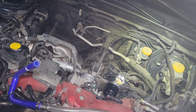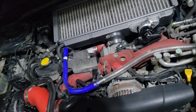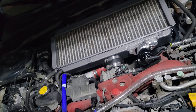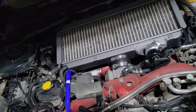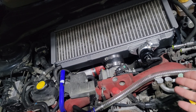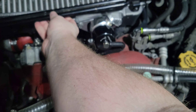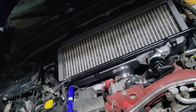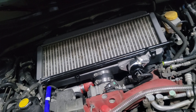The intake is way cleaner, everything's way cleaner, and the blow-off valve is installed properly - but it's still hitting the PCV pipe. I don't think it would make a difference with the Turbosmart in there or not. This just will not bolt down into place unless I cut the horn, or maybe just run some hose myself with some fittings - some half-inch hose. I might do that.